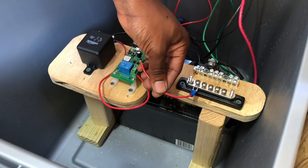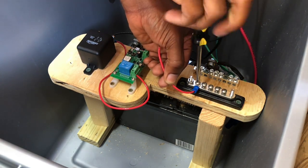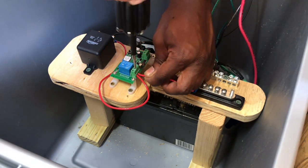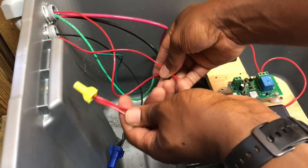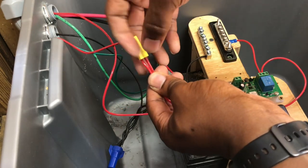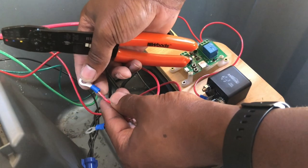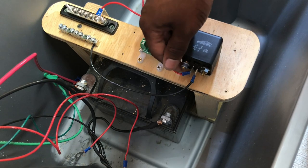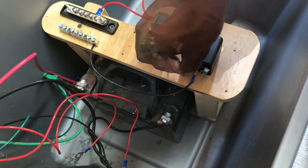Please understand that the content in this video is not intended to substitute professional advice. Always seek the advice of a qualified electrician for any questions you may have regarding electrical work. Next, I disconnected my temporary positive connection to my water pump, since now my heavy-duty relay would be responsible for opening and closing this connection to allow the pump to run. Once my ring terminals were crimped onto the positive wires from my water pump, I connected the wires to my heavy-duty relay.